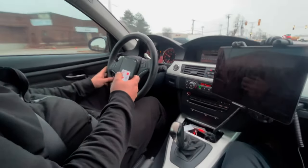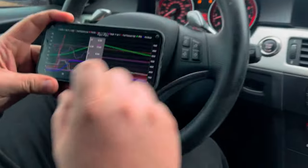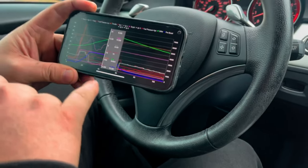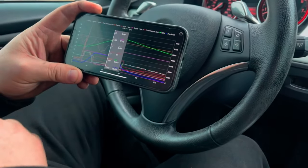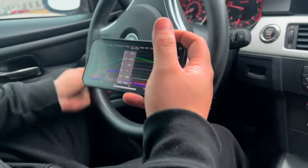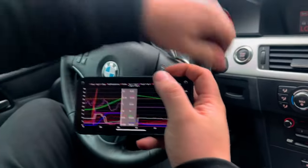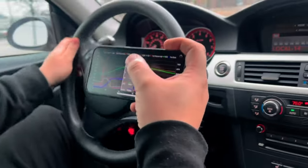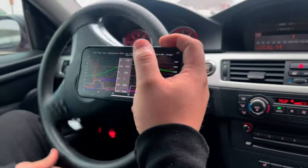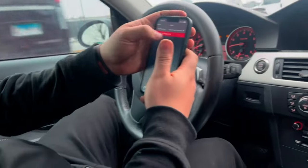I can kind of decipher these logs just by looking at them because I've done so many. I can see where we're at — at 5,484 RPM we got pretty good numbers, no timing corrections or anything. We're at 16 pounds of boost targeting 17, so we're not too far off. 73 PSI was our low pressure, 1,100 was our high pressure, which is pretty good. Trims are at 31, so we might need a little bit more fueling there — it's not crazy. Overall it seems pretty good.